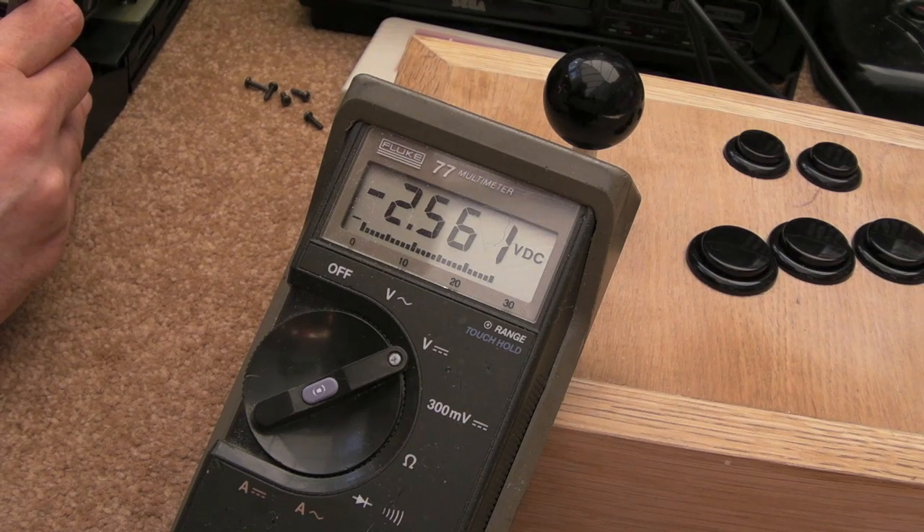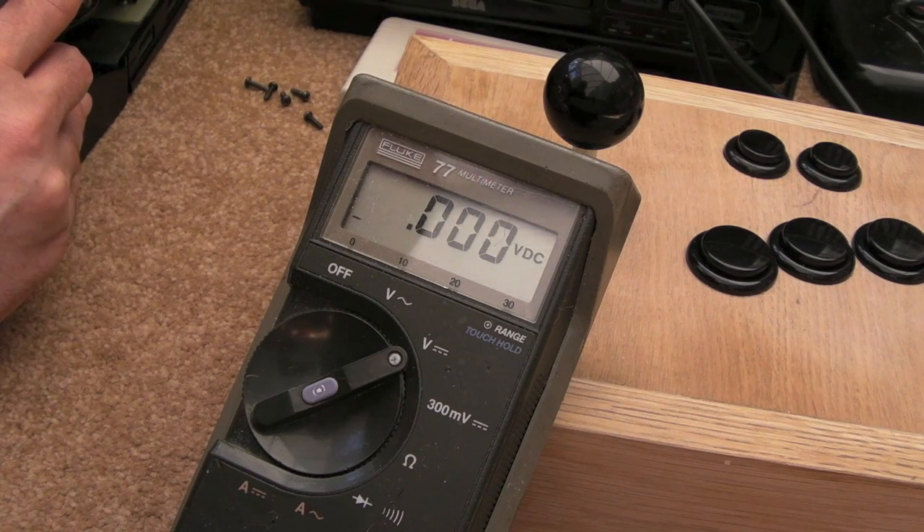So you can see there, I've got it in minus again, just because like I say I have the probes — my negative probe's got a really sharp point on it, so I'm using the negative to measure the points of the RF test pad. So you can see there: minus 2.561. Now that's with the tray open, it's not doing anything, so I'll close the tray and just monitor that whilst it spins up.